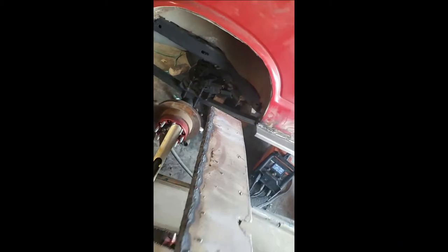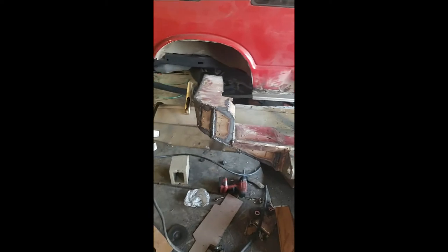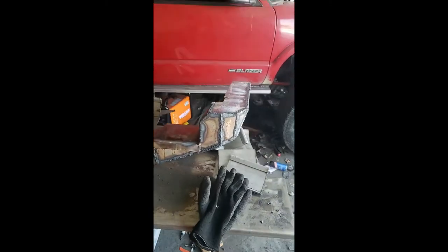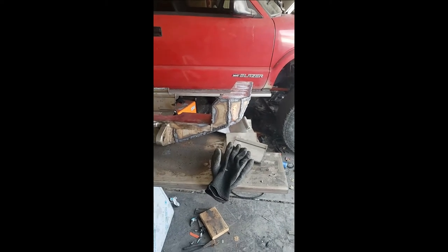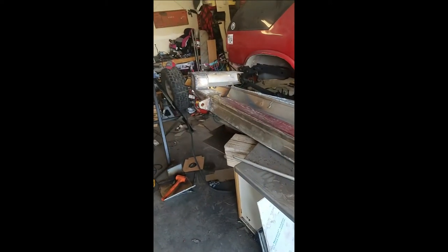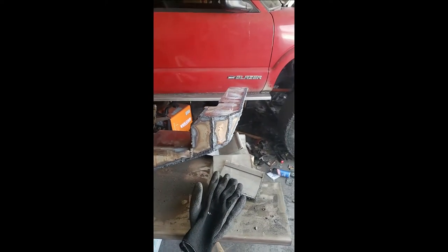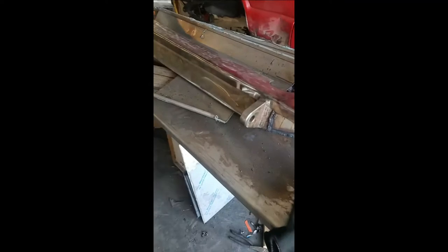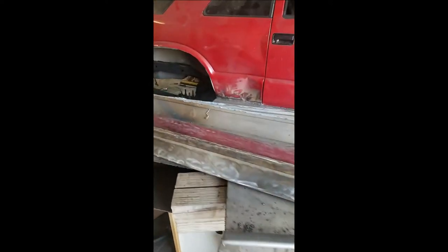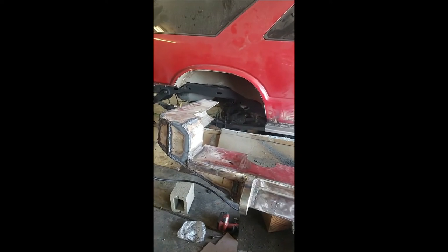Since I'm doing that angle, you can see how it just drops the balls on the sides — looks like total crap. So I'm going to get a grinder and grind absolutely everything on these edges and make them round. I thought about painting it to cover the bad welds, but when I grind the crap out of it and roll them over... It works really well when you go real thick because of those big balls — you knit it back and forth and it's fine. But when you do little tiny spot welds and just move that way, it just splatters everywhere. You have to go thick. There's no little touch-up because it's so hot and feeding so fast.